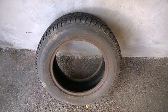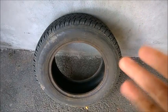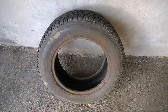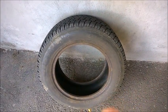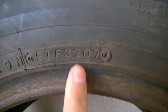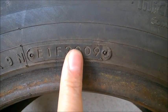When buying a used car, or going to buy a used set of tires, or even new tires from a discount place that may be older, it's always good to check the fabrication date for that specific tire. Most of the time, when you look around the sidewall of the tire, it will show four digits. The first two digits are for the production week.